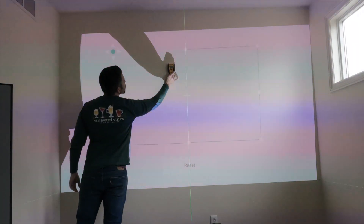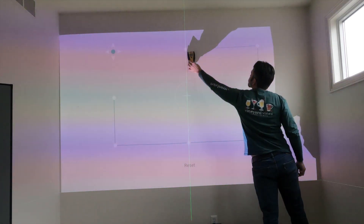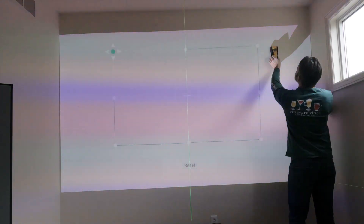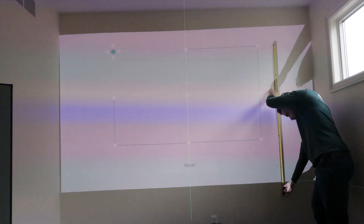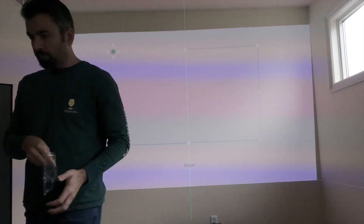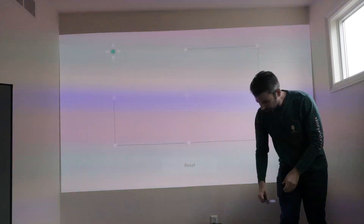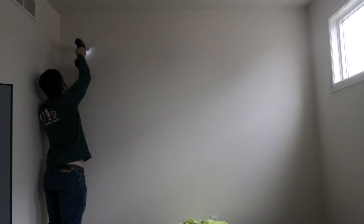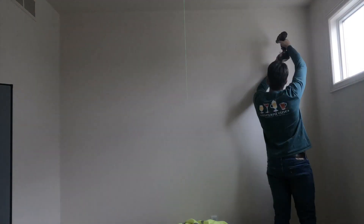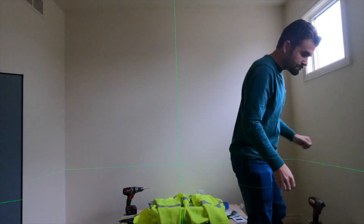The instructions even include wall installation directions. They'll tell you where to drill the holes on your wall and how to measure left, right, up, and down to make sure your Akia CLR4 screen is hung in the correct position. It is always important to set up the projector itself first — get the image on the wall, measure it to size (in my case the 115 inch size for the CLR screen), and then place the screen over that image to make sure both the left and the right side line up correctly.